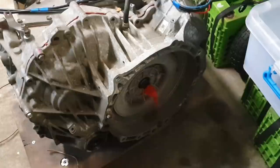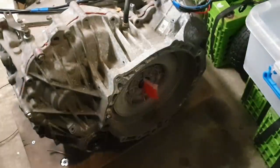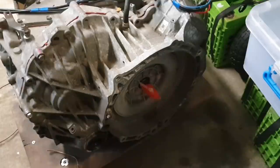And we can see that we now have our motor rotating in open loop mode. That's exactly what we want to see, just a low speed, like so. And this proves that our inverter, VCU, motor, connections, high voltage system, the whole lot are working as they should.